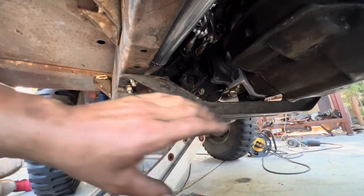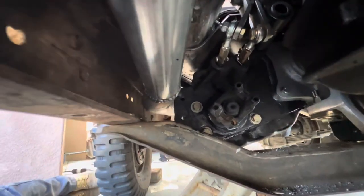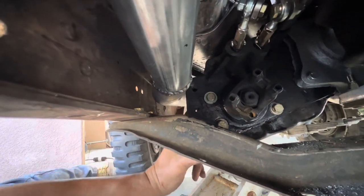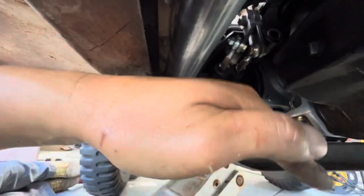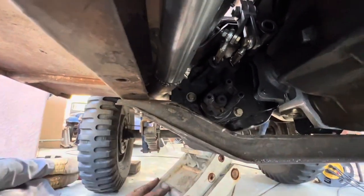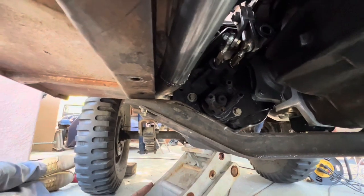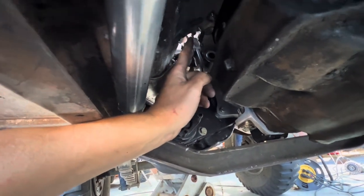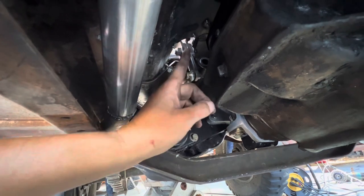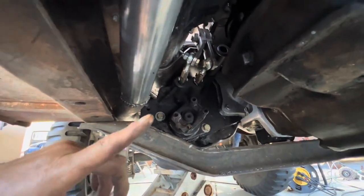Just like I did on Slum Dog, and that's been working excellent. The other thing — these two holes — I've asked everybody on the internet and nobody has an answer. We put a bracket here to help with the twist. Those two things are what you need, otherwise your transfer case will start moving, walking all over the place on good hills or obstacles, and you won't be able to get it into gear because it'll start banging against the edge of the hole up on the body.